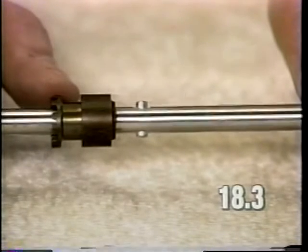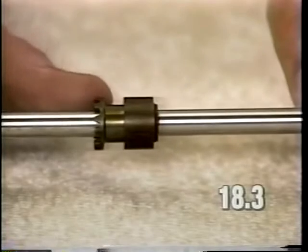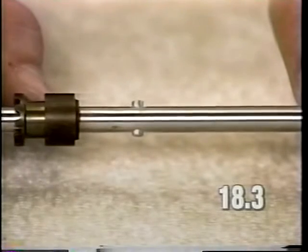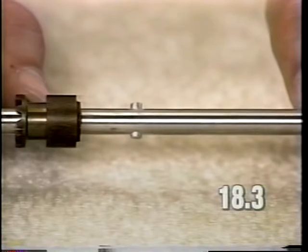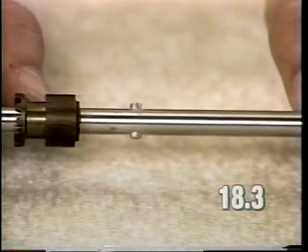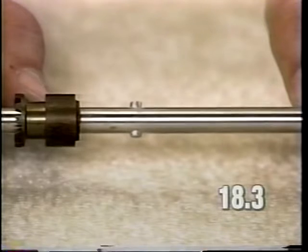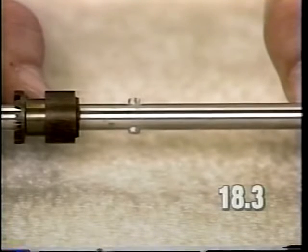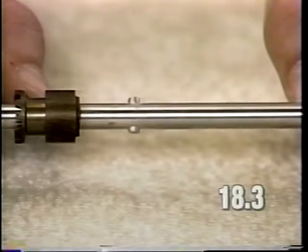If the pin is offset, the overload clutch will not slide over the pin freely. Replace the axle with a drive ball axle and gear set, part number 102092G. This will include a new axle with drive balls, overload clutch, and drive bevel gear. It is important to replace all components as described.